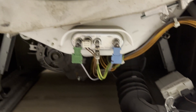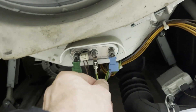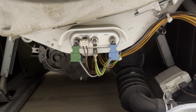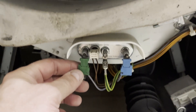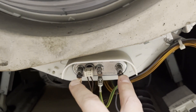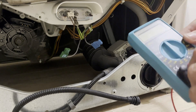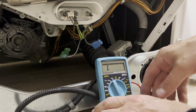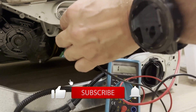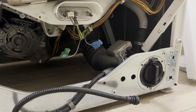Let's take a look inside. At the bottom of the drum is the heating element: two power terminals, a temperature sensor, and grounding. To diagnose whether the heating element is faulty, disconnect the power terminals and use a multimeter to check the heating element for continuity. If the heating element has completely corroded, it will not show continuity — meaning there is a break. Set the multimeter to continuity mode and test the heater. The heater is not broken, so it still works. Most likely, the surface layer has started to deteriorate, allowing moisture to penetrate inside and causing a current leakage.